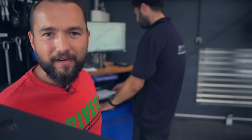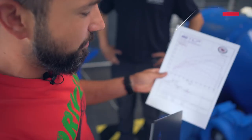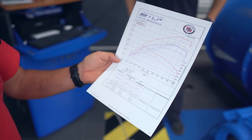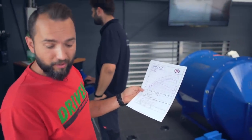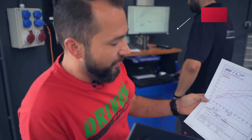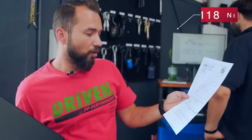So my friends, let's get to the result. Just software, nothing else. The AK47 has now done the tuning. We have a performance of 775 PS and 1072 Nm. We're running a boost of 1.9 bar to the end of the rev range, at 21 degrees ignition timing. Lambda is 0.80, knock retard is 2, and for some cylinders it's 1.5 — that is perfect. So we have a gain of a good 135 PS and about 150 Nm. We are now checking 0–100 and 0–200.